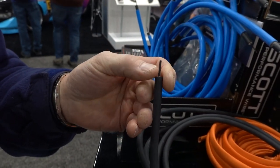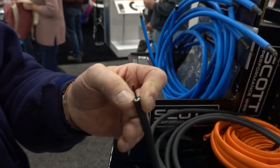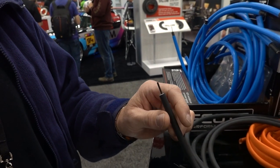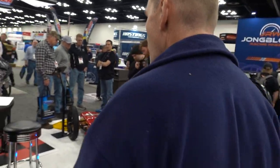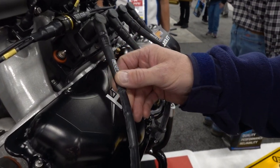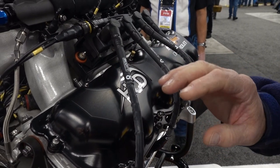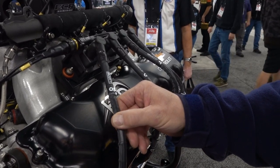We're talking about conductor wire — conductor is key. This is our 30 Gold wire, so 30 ohms resistance. The conductor here is the finest you can buy in the industry. Like a Super 40 from Moroso, their 40 is 40 ohms resistance, so this has less resistance, higher conductivity. The best thing about our wires is the noise suppression — you do not get noise for all your electronics. So this wire goes on this engine right over here, which is a Childress NASCAR engine — as you can see, you couldn't put any more electronics on an engine.